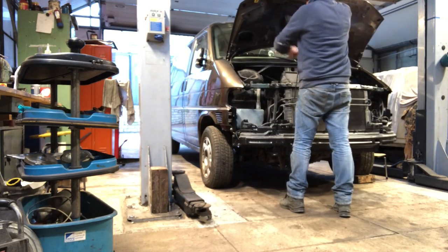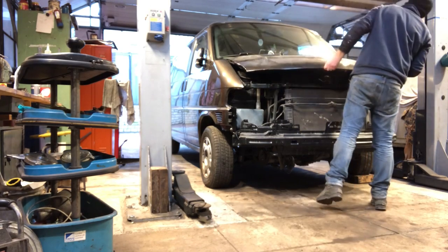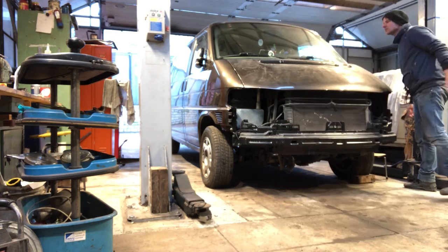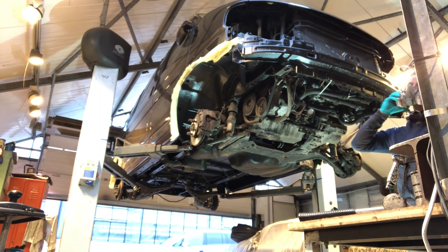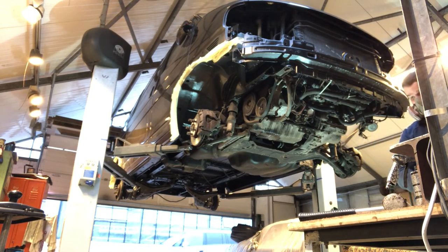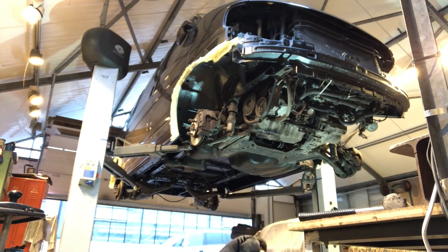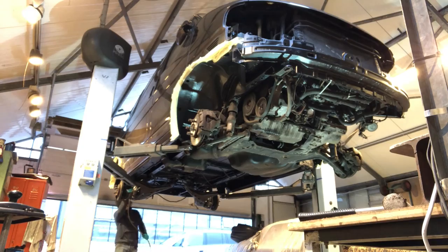Checking the gaps, making sure nothing touches the first time I close it — wouldn't want to take the paint off the edge. And just when you thought she'd had enough coats underneath, another couple of coats of the bitumen-based underbody deadener, which is a self-healing coat. It helps with stone chips — if the coating gets damaged in hot weather it melts back across and covers the damage. Really want to keep water out of this undercarriage so I really don't want to have to do this job again.